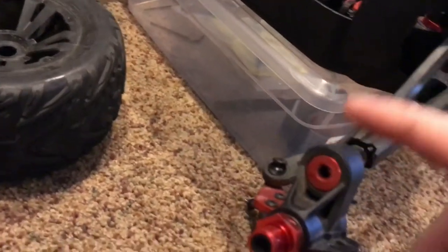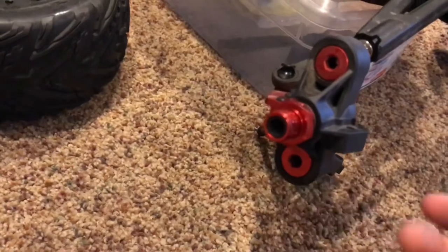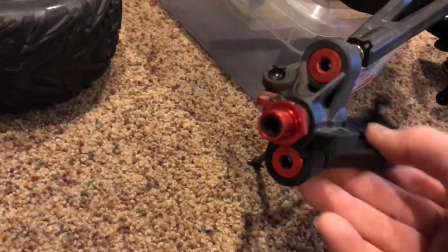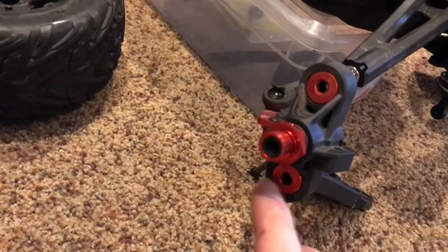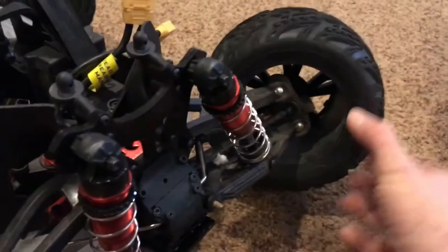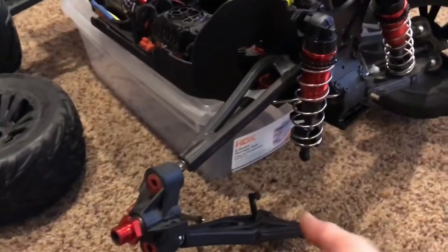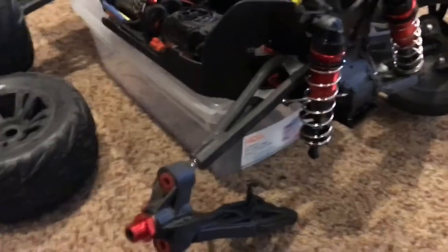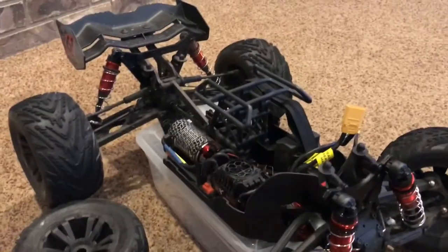Leave it kind of loose. I had to check the tightness on this one just to double check — it is a little bit loose. I snugged this up at first and it was just real stiff and not wanting to move a lot. So tighten it up and then make sure you back it out a little bit so that it's got a little bit of give. As you can see, even just wiggling this tire, you can tell that it's got a little bit of give there. I'm going to go ahead and button this thing back up and hopefully I'll have some more videos of me bashing here pretty soon.